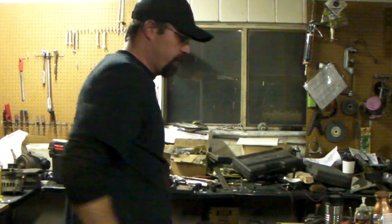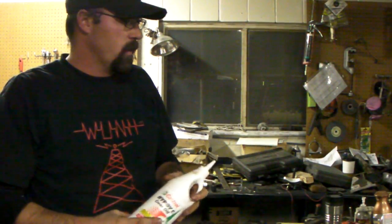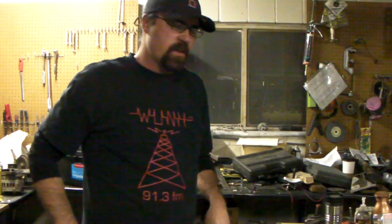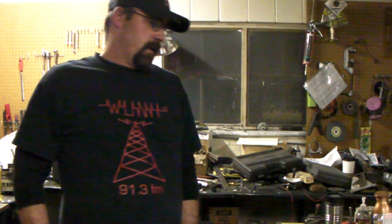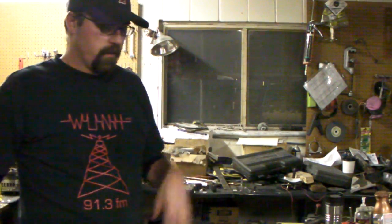I'm just going to go back with regular conventional oil, 80-90 weight, and it's usually about 2 quarts no matter what axle you're looking at. So make sure you have a couple quarts on hand. When you go ahead and fill it up, pull the fill plug. It's going to take a quart without doing anything. Get that second quart ready and squeeze it in as fast as you can. Once it starts to puke out at you, throw the plug back in. You're supposed to be able to reach in with your finger, and no. Just fill it till it starts to puke, and then you're done.